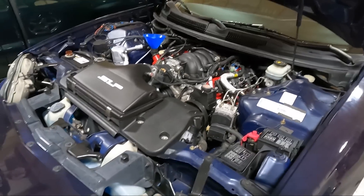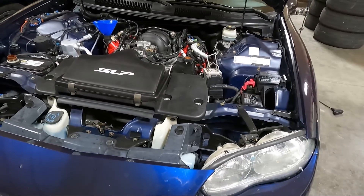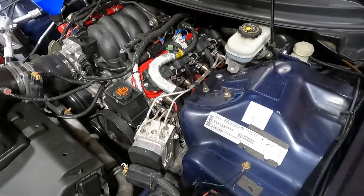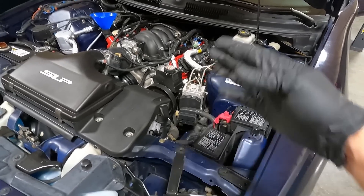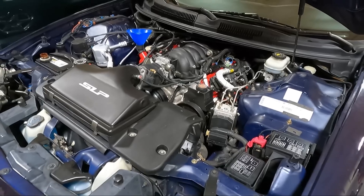We got everything back on including the belt and all the plugs. One of the hardest parts is getting the plug undone without breaking the wire, and also putting the power line back on the rear — way easier with a K-member like we've got. We'll check the oil level, fire it up, and hopefully everything works. Belt alignment looks good — sometimes aftermarket alternators don't have the right depth, so watch for that when you start it.